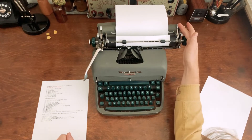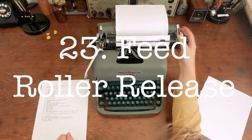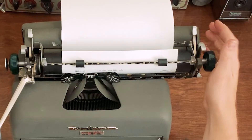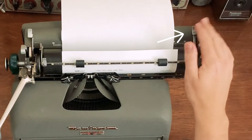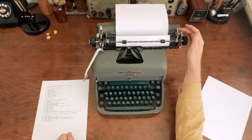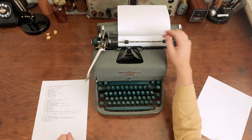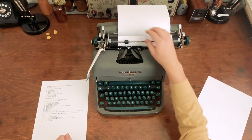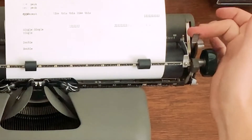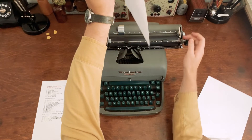One of the last pieces to know on a desktop typewriter is the feed roller release lever, which is always on this side. It has a lot of travel, so it's distinctly different from the carriage release. When you want to pull a sheet of paper out, don't just yank it. Pull that lever — it loosens the feed rollers on the bottom and then the paper slides out freely.